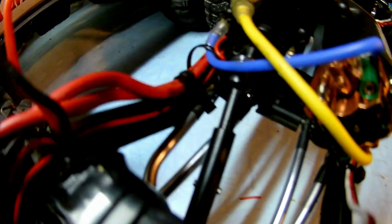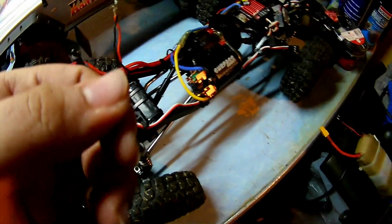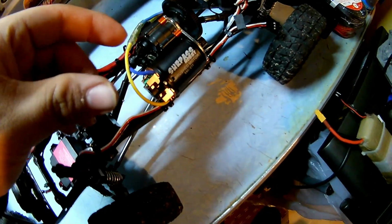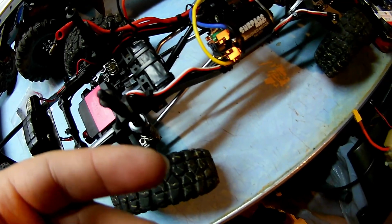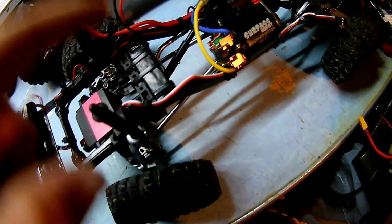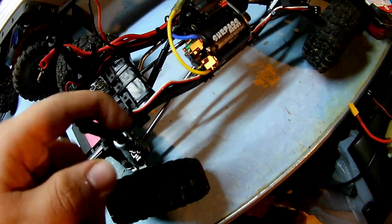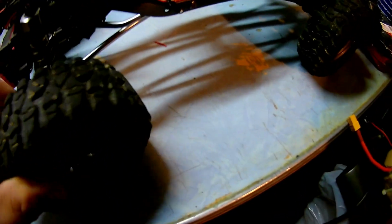And the other upgrade I did, which you might not have noticed, is I upgraded these stock shafts to the aluminum ones, which I have in here. They're CV and they're aluminum. They're much better, because with the old ones, when I put in the 5.4, because this car, if you don't know, came with a motor like this and a smaller transmission. This transmission is not stock, and neither is the motor. So when I was using the car frequently, the stock shafts, because they were not CV, would scratch each other and the pin would wear out. They were not horrible, but these are way better. So I bought those as well.